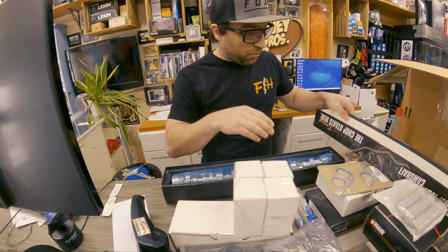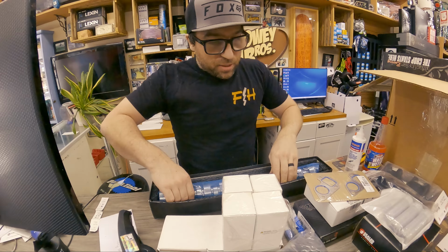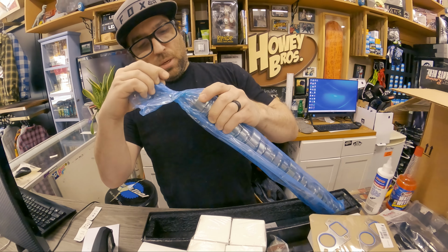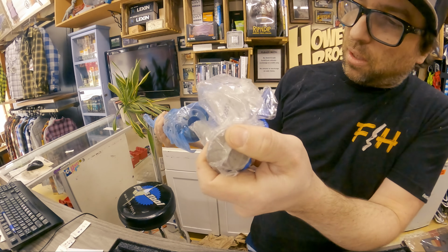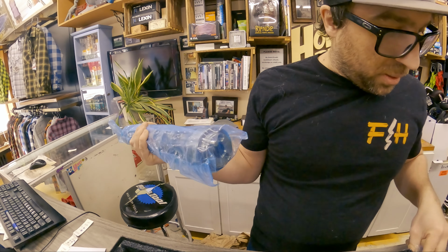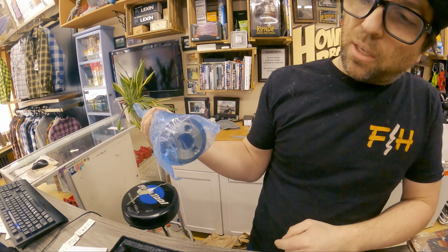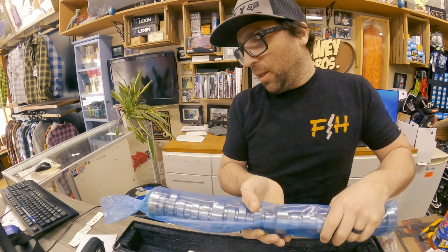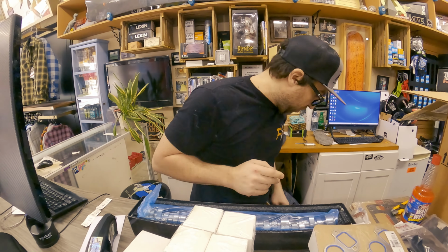I do still have to get a conversion kit. I wanted to get the cam first, because this is why we don't need this. So this cam is a 3-bolt. The old cams, or what comes in a 5.3, use this bolt that goes up the center. These replacement ones use the old school style 3-bolt with pin, so you just have to get a little adapter for the front of your engine. Brian Tooley does it as well. I just wanted to double check everything once we got this and kind of do it after the fact.